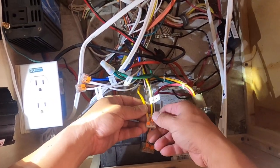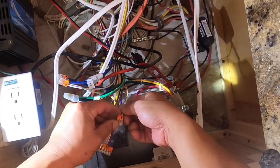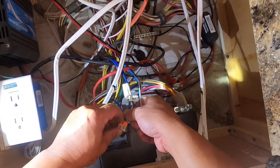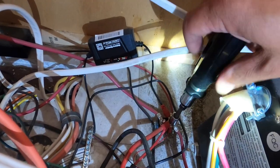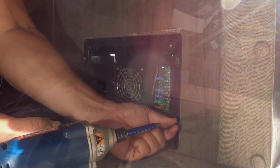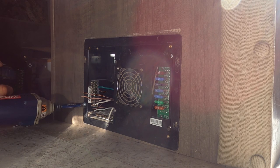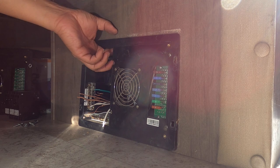Disconnecting the DC circuits was extremely easy — the manufacturer used these flip connectors. You simply flip up the orange tab and the corresponding wire pops right out; no cutting, no muss, no fuss. My green wire was crimped, so I cut it at the connector, released the red wire from the terminal leading to the battery, and released the white wire from the bus bar secured to the RV. Now you're ready to remove the entire power center — simply remove the screws on the exterior of the cabinet and the power center should come out of the opening easily. Note those DC fuses on the 12-volt side of the power box: keep those handy because they will be reused in the new power center.